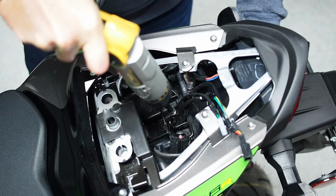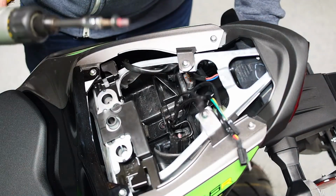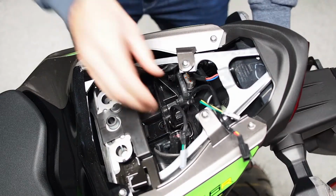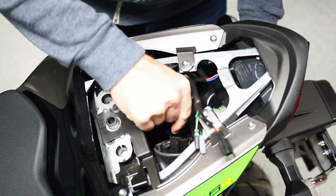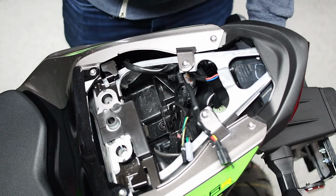And then when you're removing the fourth and last bolt, just hold on to the fender with your free hand so that it doesn't lock up the bolt, essentially bind it up, and then guide the, take that clip out. So we'll reuse this on the way back in, the new fender.